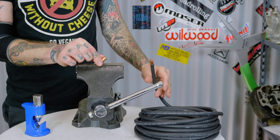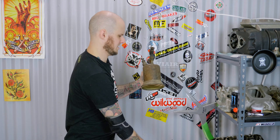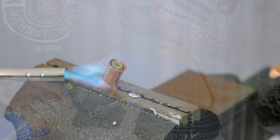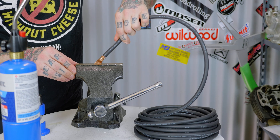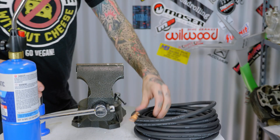Now with my cable stripped back, I stick my solder slug into the eyelet where it belongs, then clamp it in the vise to melt the solder. I grab my propane torch — simple, straightforward, nothing special — it gets the job done quickly, easily, rather than a heat gun or big soldering iron. I fire up the torch, heat up the eyelet, and once it gets to the point where the solder slug melts, I stick the battery cable in. The hardest part is making sure all conductors go into the eyelet without any sticking out the side. I hold the connection together for a few moments so the solder cools and bites into the cable, holding a mechanical connection.